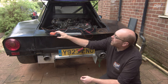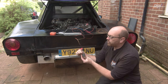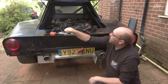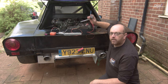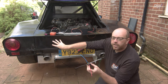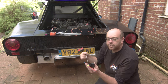I managed to find the connector in the loom that actually plugs onto that because we removed everything those three cables depended on, so we could just completely destroy this and get it out of the loom. I've left the other two terminated with some heat shrink so if we need to add more supplies we still can. We now have a nice big fat power cable which will run all the way across to this side of the car where we can put in the power relay. This will take power in one side, hopefully triggered automatically from something further forward in the loom by the ignition, so these turn on at the same time as the car.